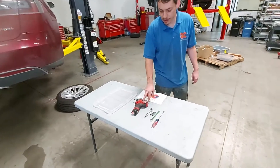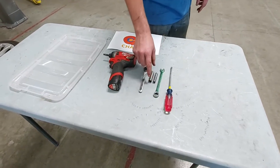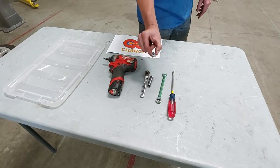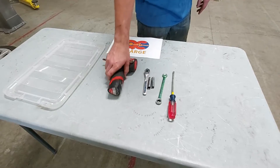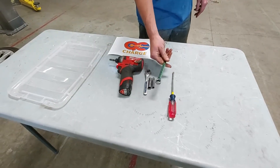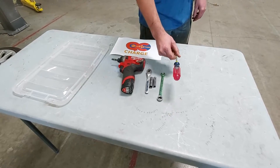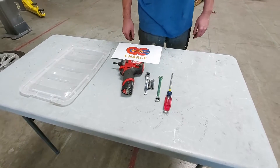The tools that we're going to need — this can be done with just basic hand tools to take out all the screws on the bottom cover. You're going to need a 10 millimeter socket, and depending on the date your car was produced, there might be a couple of eight millimeter bolts. You can do this with just a regular ratchet; in my case I'm going to be using an impact driver for that part. You're also going to need a 10 millimeter wrench — a ratcheting one will be best — and a screwdriver to remove some clips. That should be pretty much all that you need.